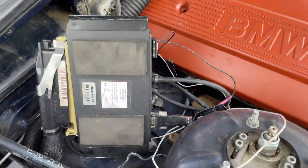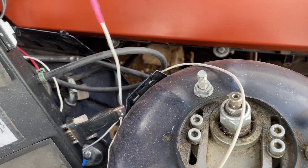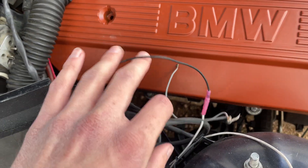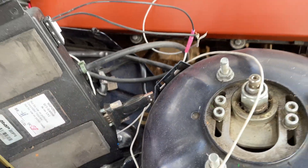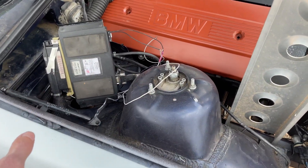The main issue I'm seeing right now is the Megasquirt has these two wires that are supposed to go to a standalone, and it looks like they're just cut off. One's for the ground for the wideband controller, and the other one goes to the 5-volt signal, and none of that is anywhere to be found. So we're going to have to order a new wideband controller for that.